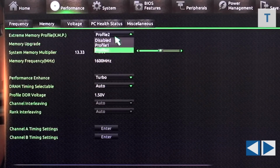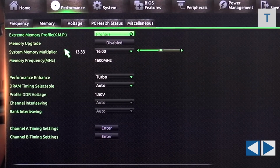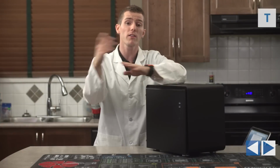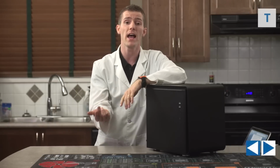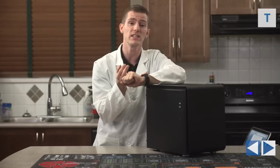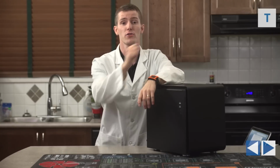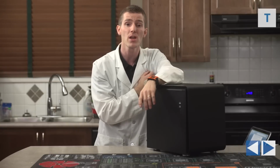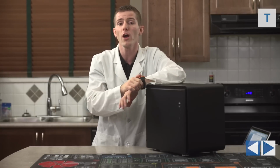Next up, Windows installation is a snap if you know how. Don't worry about the lack of a disk drive in this machine. You can just grab all of the files off of a disk, copy them to a blank USB drive, and boot from that. It's faster and more convenient. In fact, most of the techies I know just have a dedicated USB drive for doing OS installations just like that.